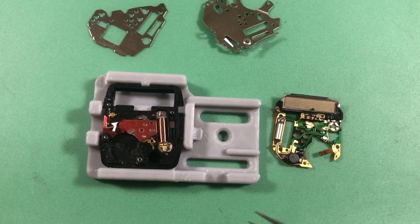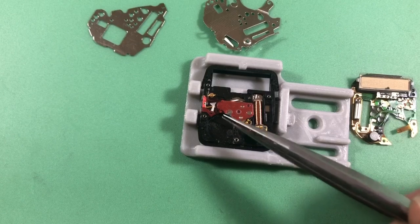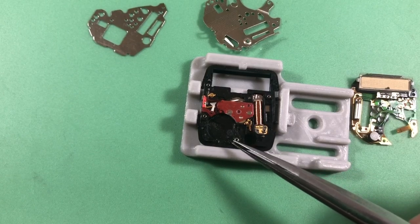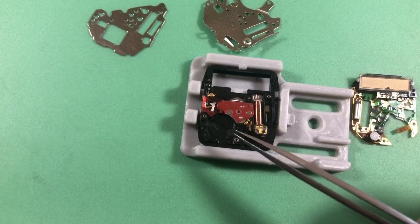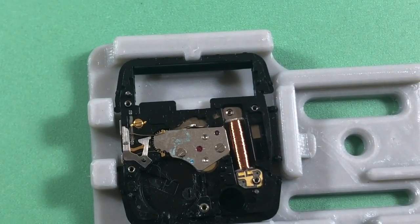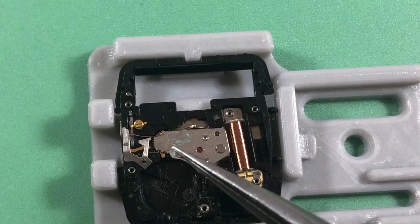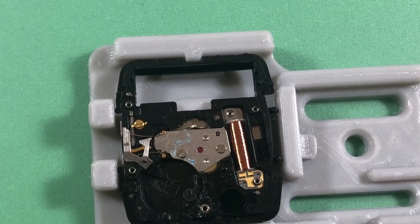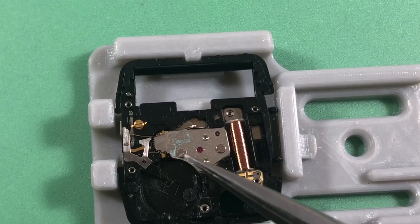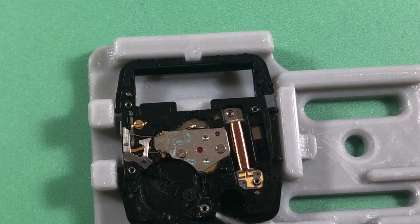In terms of the train, it's just hazy and dirty with little hairs — we'll clean it up. You got real lucky: we definitely had a battery leak, it wasn't recent but it was underneath the plastic shield. I'm going to have to use a little bit of ammonia to neutralize and clean this up. This fibrous black plastic — it's almost like a bakelite — battery acid hates it and it just crumbles into fibers.